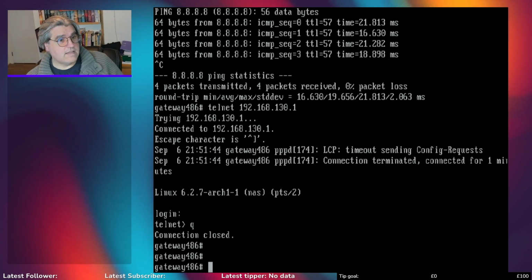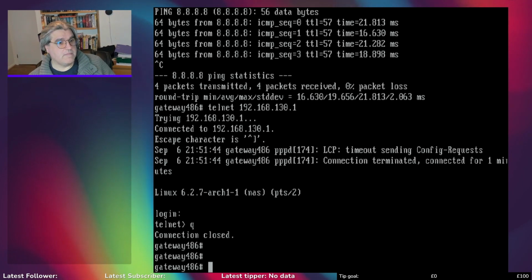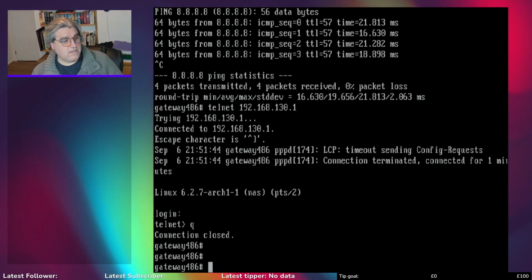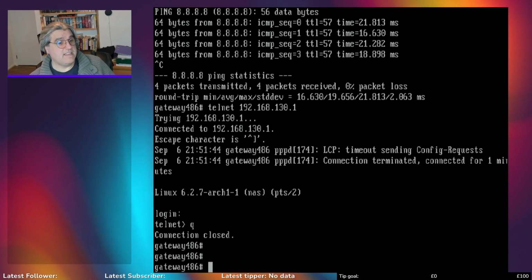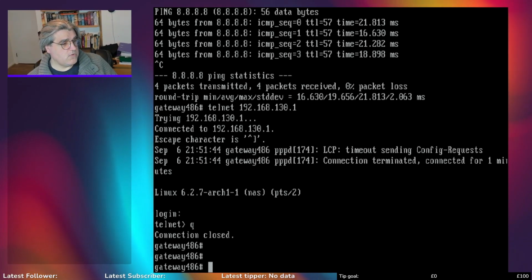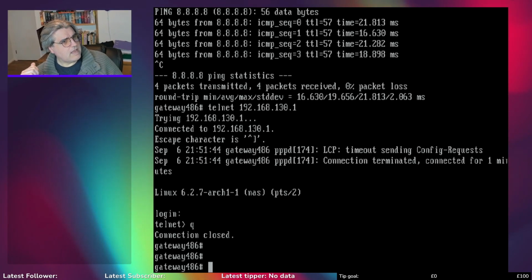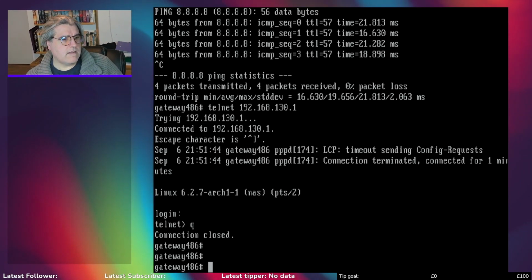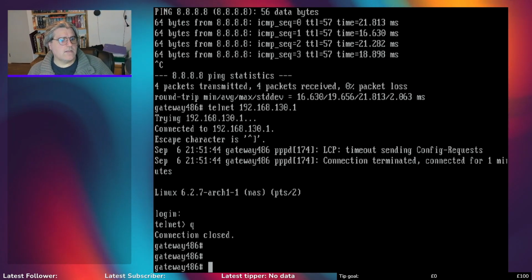Yeah, he's got these arcade cabinets, Hydro Thunder, these old early 2000s arcade boat racing games, which he's been fixing and hacking around and examining the hardware on them and getting it working on standard PC hardware, because it's just a standard PC inside. And the game requires certain hardware to run, including a Voodoo 2 for the graphics, but also a Yamaha sound card. And I've got a hunch this one that I've got might be the same chip on it that's required for that. So I might use that card in my P3 Celeron system, possibly, and see if I can get Hydro Thunder running on it. But I need to get a Voodoo 2 card as well to be able to do that.